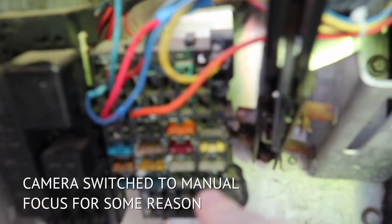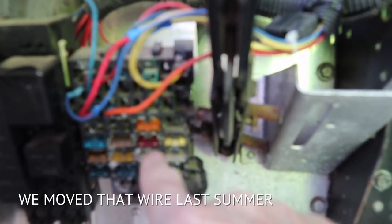I'm in the parking lot of Home Depot here, so if you hear a lot of traffic it's just the nature of this parking lot. This is the fuse box, and all of these wires in this grouping in the top corner are pretty much the areas having problems. These wires do not have fuses from the fuse box — they run as bare wires out of the plugs and have their own in-line fuses. One of those is the windshield wipers, which is the main one I want to focus on today.